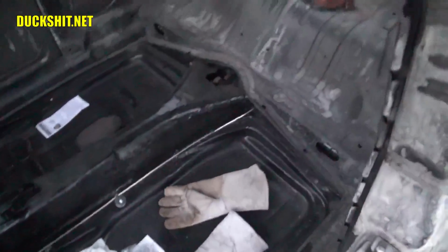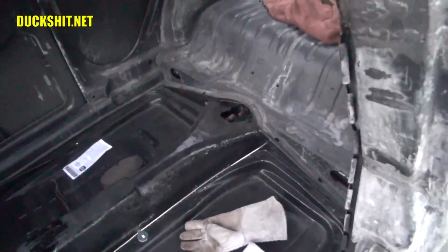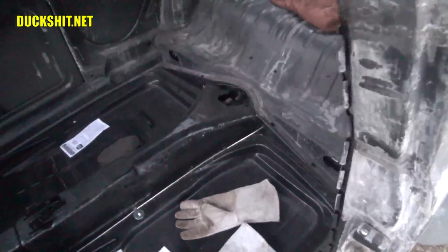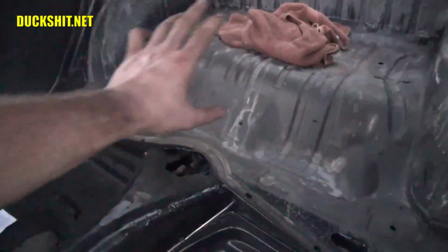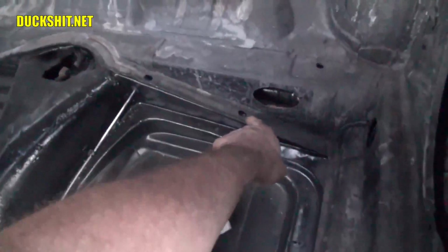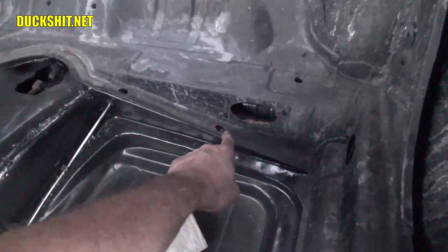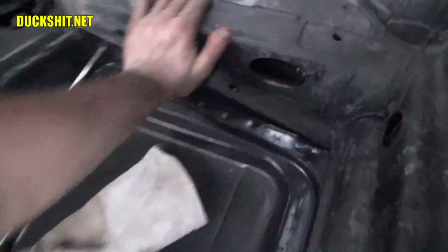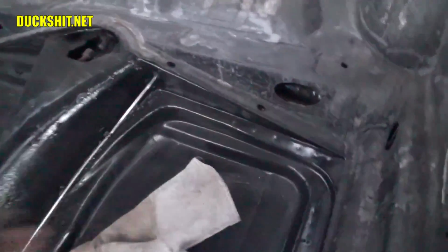Well, looking down inside of here, some of my ugly little mistakes are showing up, stuff I didn't usually talk about before, stuff I was hiding. When I put this car together from pieces, and I started rebuilding this area back here, where the rear wings go down, you can see the bolt hole kind of in there. Yeah, there's no alignment. The hole is much further back than the wing is. And that's a mistake I made on a lot of these whenever I fixed them. For some reason, I always bring this too far forward.